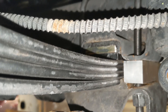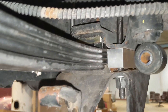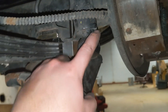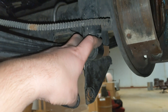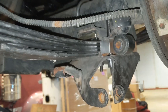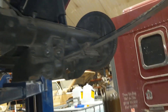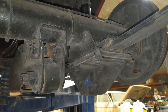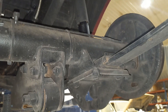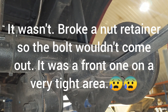This is the shim that rotates the axle up a little bit to help with drive shaft alignment. The springs still look good. The shocks I haven't hooked back up yet because I'm getting new shocks — I'll have to lower it before I can do that. This side is pretty much done now, I just got to repeat it on the other side. Now that I know what to do and what not to do, hopefully I can do it a lot faster. That should be it for this video.